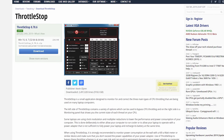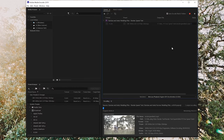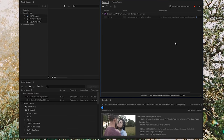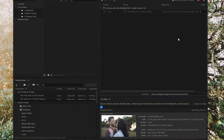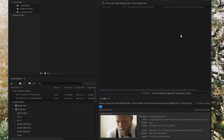There is one other thing I tried to speed up video renders and cut back on CPU throttling. I used an app called Throttle Stop to undervolt the Magnus CPU. When I did that, I saw that my render times dropped from 18 minutes 34 seconds to 17 minutes 42 seconds for my 4K video, and from 5 minutes 45 seconds to 5 minutes 11 seconds for 1080p. I also saw CPU temperatures drop by up to 5 degrees Celsius — and that was at stock fan speeds.